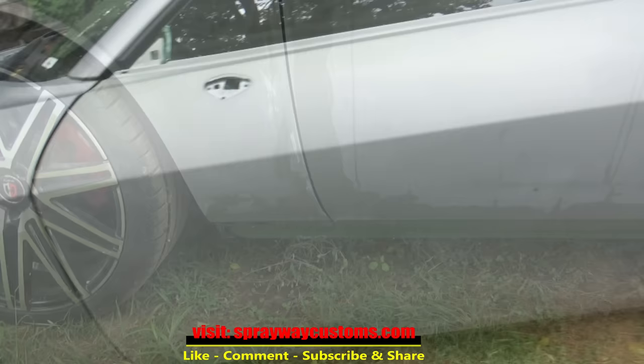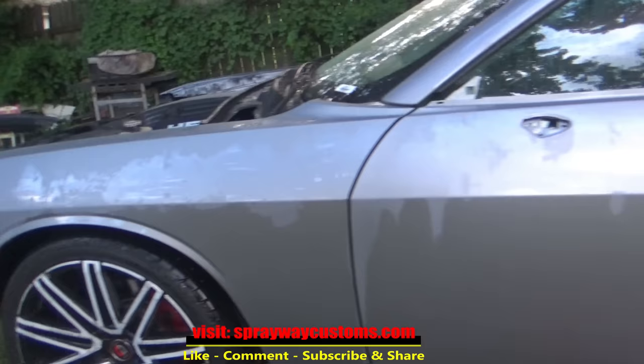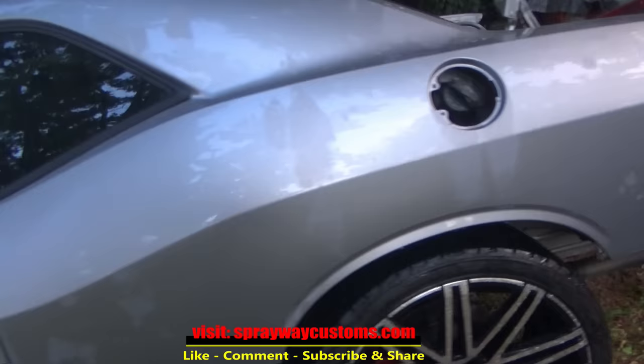Done with the feather edging. Now I get me some soap and water and wash the entire car off. Just finished cleaning it up. Now I'm gonna put it in the shop, let it dry up. Then I start masking.